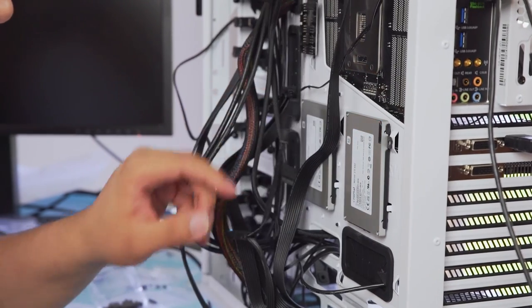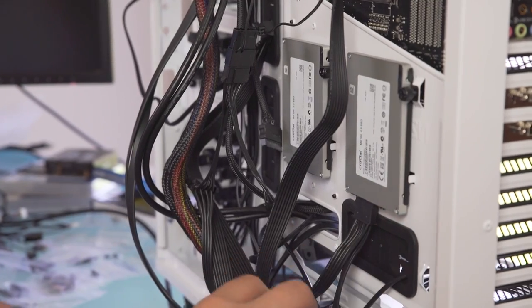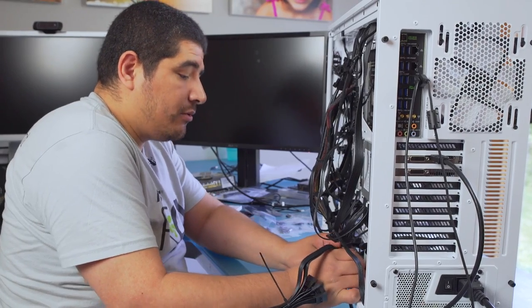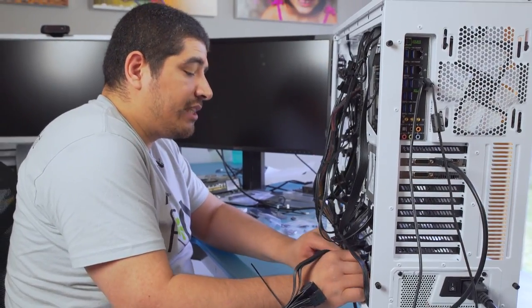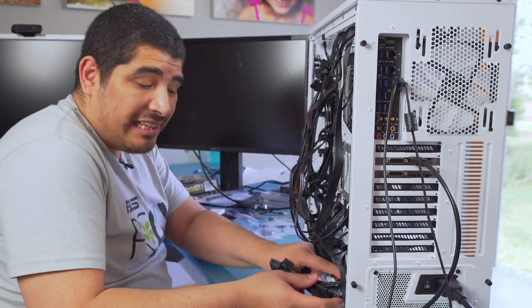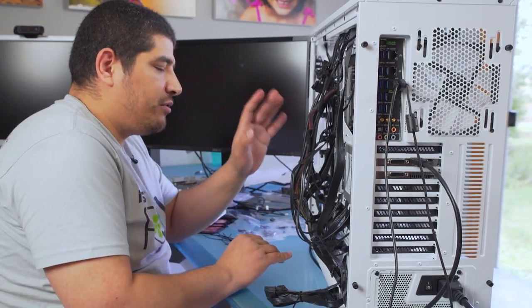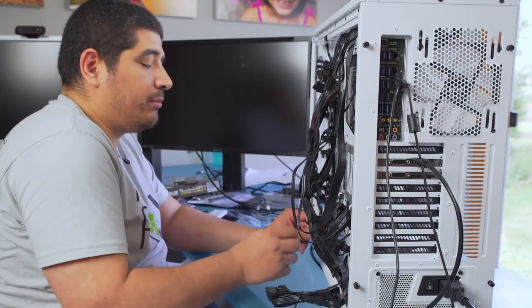To know what his thoughts were about a RAID system versus an SSD for video editing for your main media drive. With a RAID, because you are physically utilizing those two drives and combining their workload performance, you are getting a more consistent improved level of performance versus in a software-based environment. Depending on how that software and its algorithms work, it may not exactly benefit you in every scenario. With a RAID configuration, it would be more consistently improved.